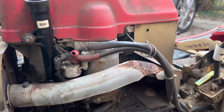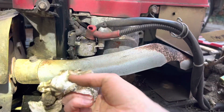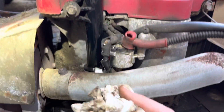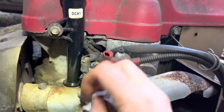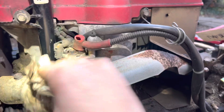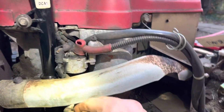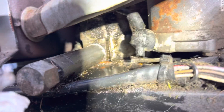We've clearly got work to do on this tractor - it's full of grass and mud. You definitely need to jet wash it and then you can see what you're dealing with. If it's leaking oil, the engine oil is going to be low, and that's not good. I'm surprised it's not smoking actually, because that's the exhaust pipe. I need to do an oil change on it anyway - that looks like the oil drain plug. It's pretty grimy under there.